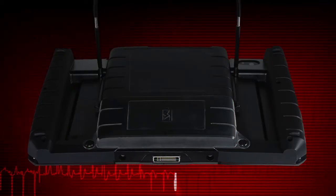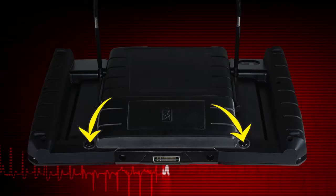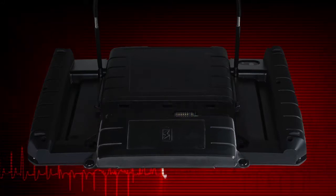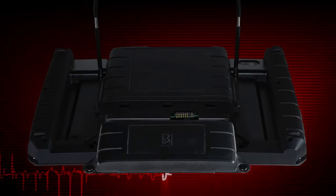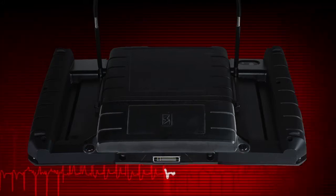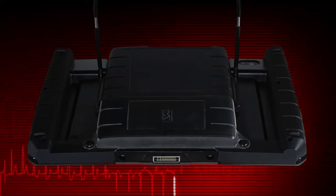To replace the battery pack, open the stand. Loosen the two battery pack screws, then carefully pull out on the bottom edge of the battery pack and lift it out. The battery pack is installed in the opposite manner. Be sure to only snug up the screws and don't over-tighten.